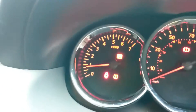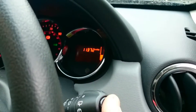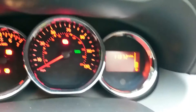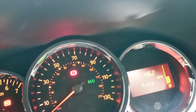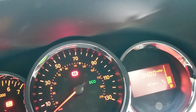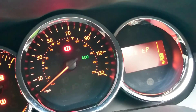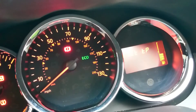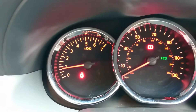The top master warning has come up as an amber as well. So I've reset the tyre pressure to the correct pressure. To reset the system, using the multifunction button on the end here, scroll through until you get — there we go — 'Set TP tyre pressure'. Now hold the button down on the end and watch.